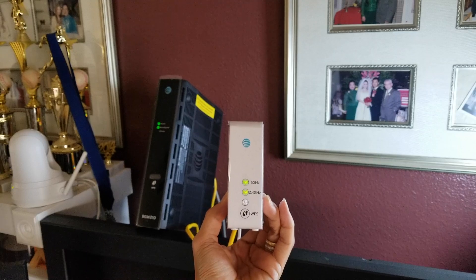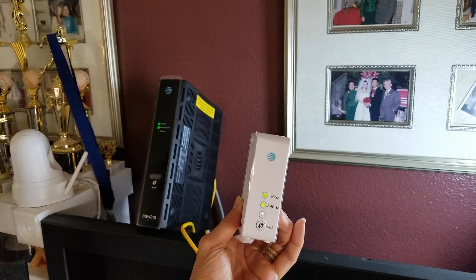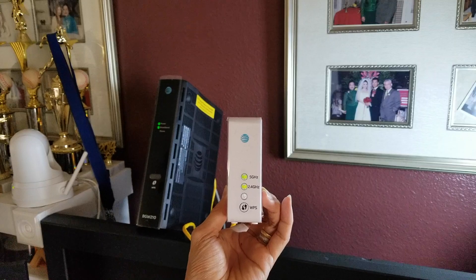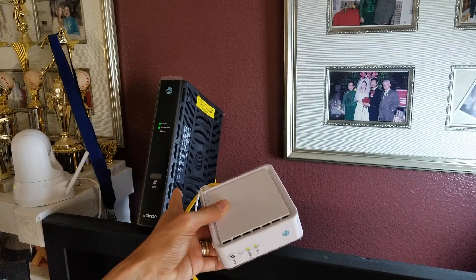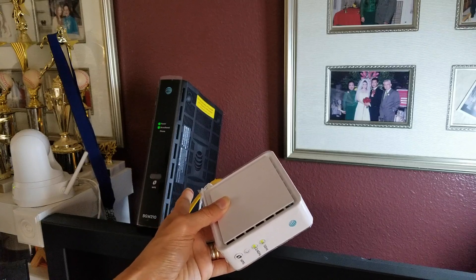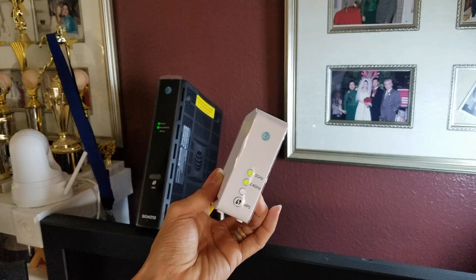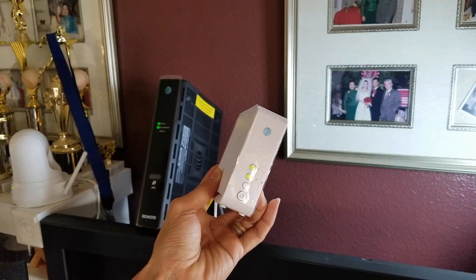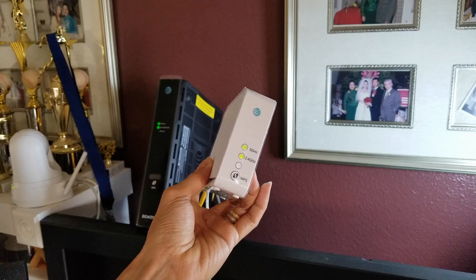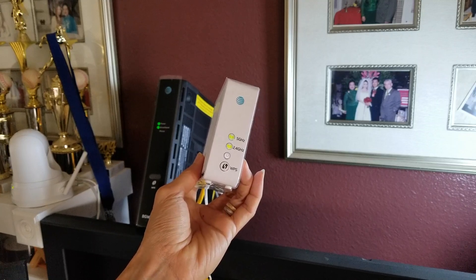If that still gives you a problem, be sure to reboot your wireless router — which is your modem plus router combo. Check all the cable connections and make sure they are clicking tight with a good solid connection. You want to unplug it and power down, then power up — unplug the cord from the back of your wireless router, leave it unplugged for 15 seconds, then plug it back in. After that, unplug the power cord for the Wi-Fi extender as well. You may need to wait up to 3 minutes again for your wireless router and Wi-Fi extender to complete the reboot.